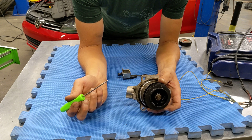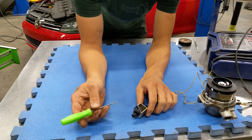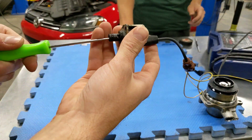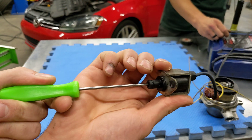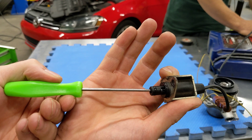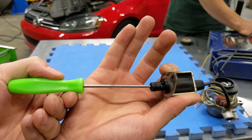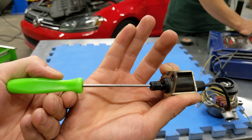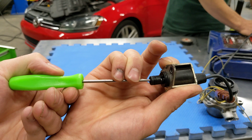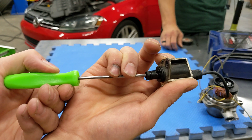So without further ado, let's see these parts in action. We'll start with the solenoid. This is the fail position, which does not route coolant down the center passage — so shroud open. And here it is when the ECU closes it down: you can see it's pushing that pin out as it opens the valve, and that's what allows the coolant to flow to the passage in the center of the port.